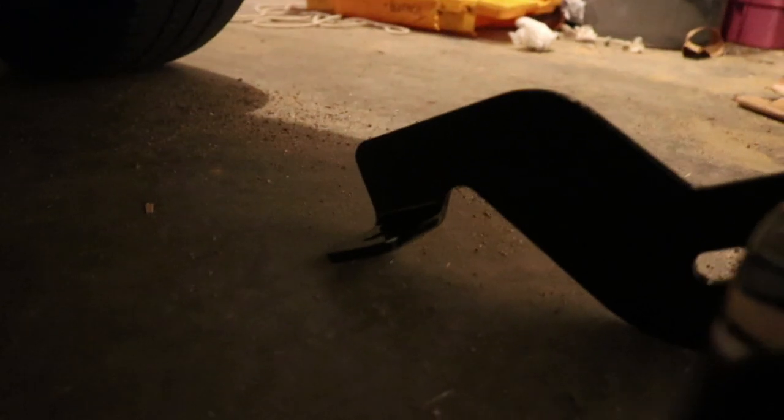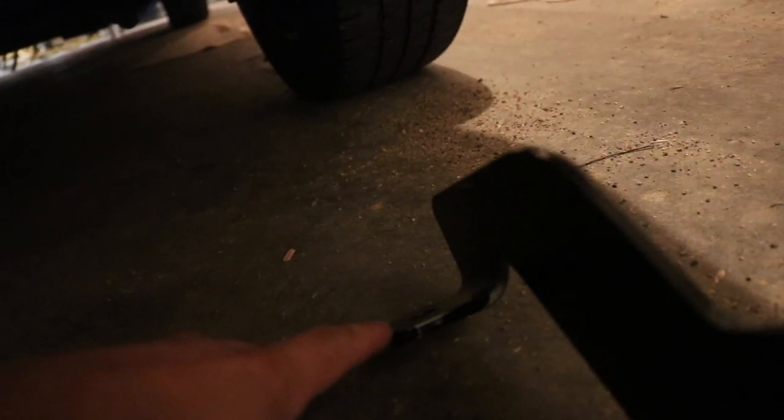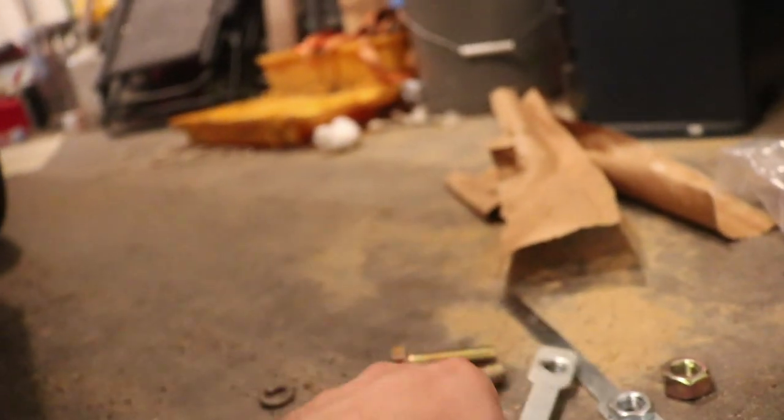Yeah. The installation of this hitch should be pretty simple. On each side, there is a hole, which you can see on the right-hand side of the frame there. And that hole mounts to these tow points on either side. And then there's a hole in the frame right here. And I believe it just says I have to widen out the hole, but it'll attach right here and you fish up these plates.